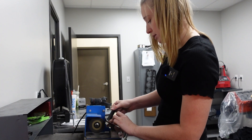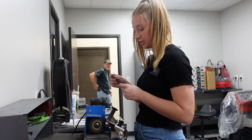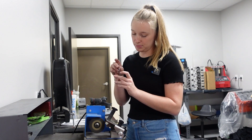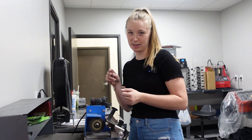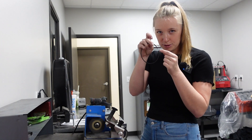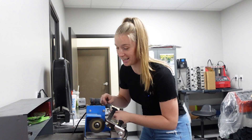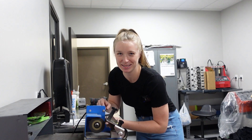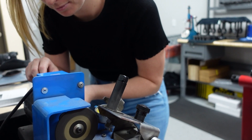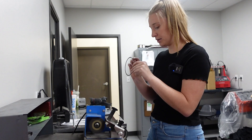That hit five on one side, so I take it off. Then I bring it over to the polisher and sand down every little edge to get rid of the sharpness — this is more of a feel thing, because if it feels sharp it'll probably scratch your block. I go around and polish off every one of the four edges on the ring. You do have to be careful with how much you're bending the ring, because it can snap since it's really delicate. And that feels so much better.